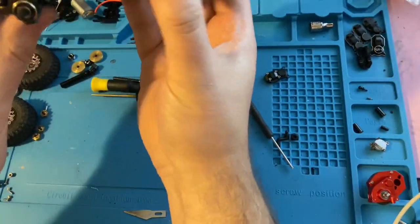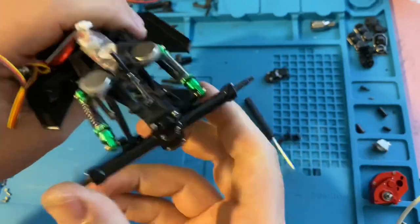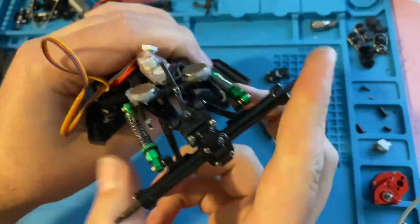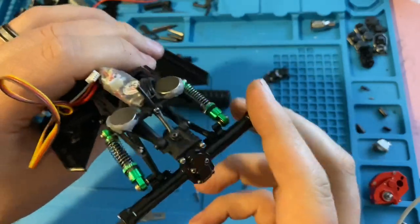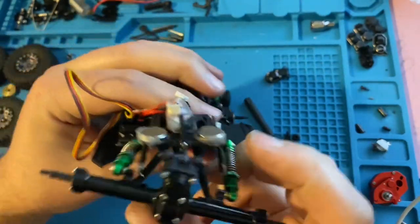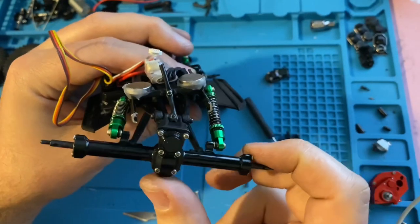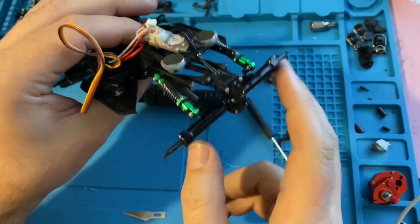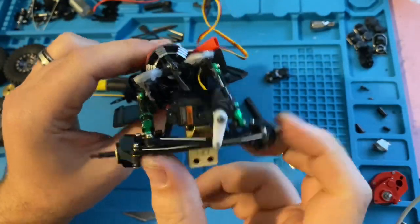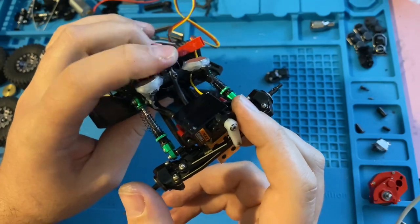You get to keep all the articulation. If you go from side to side you lose all that flex. Right now my limiting factor of flex is my links and my shocks — not my limiting strap. The limiting strap is only the vertical part. The geometry says you want it in the center as much as possible and as close to the pivot point as possible. It's hard to do on these because you have drive shafts in the way. We can shorten or lengthen the straps since we left a little extra. The front might be a little too tall — we'll have to shorten it up just a little once we get it all together.